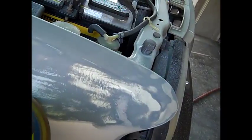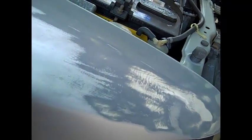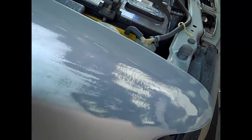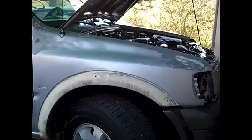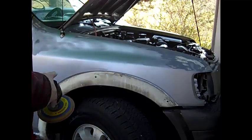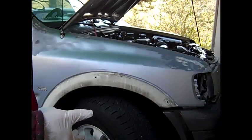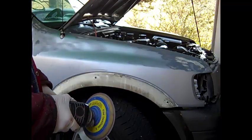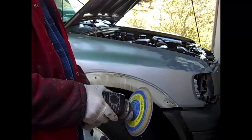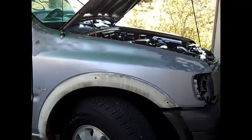You can see where I've sanded it — it's got weather cracks because they didn't prepare this fender correctly. Looks like they wiped it down with grease instead of a cleaner, then sprayed black primer over a white fender, then sprayed spray can silver on top. I want to discuss this: there are a lot of videos about spray canning cars. They make some cool spray paints — even activated polyurethane paints in spray cans — but keep in mind that to get it out of a can it has to be thinned down, so it's not going to be high quality paint. Even if it looks good the first week, it's going to deteriorate and make it harder for whoever does a proper repair later, because this could very well just bubble up like paint remover and cause a reaction.